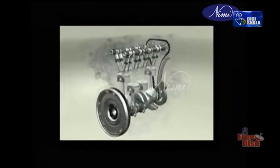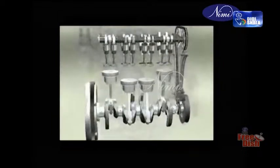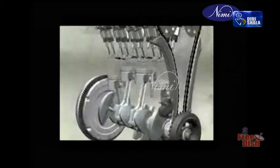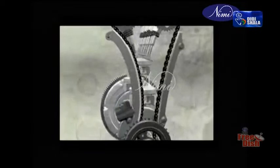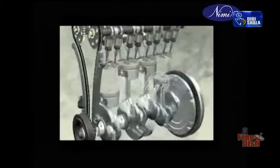Multi-cylinder engines. A smoother flow of power from the crankshaft is obtained when more than one cylinder is used. The extra power impulses are spaced out evenly throughout the two revolutions of the four-stroke cycle. The flywheel of a multi-cylinder engine is lighter in weight.